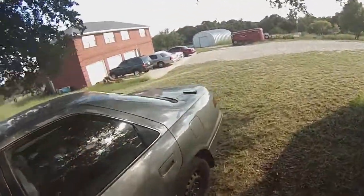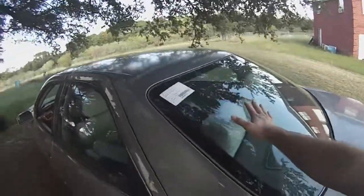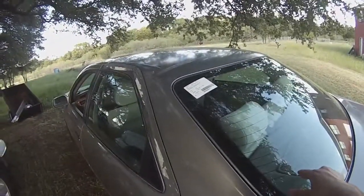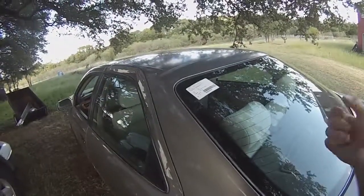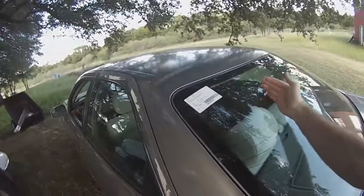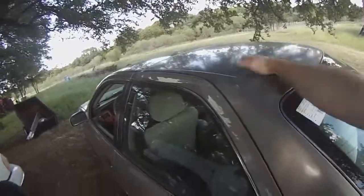What you do want to do when you put the glass on is this: some windows are going to have locator tabs like this one did up here. However, when the junkyard took this out of the old vehicle, they broke the guide pins a little bit. The tab was there, but the actual pins that hook in, the metal hooks on the vehicle where it hooks into it, were broken off. So it kind of worked, but I did have to put masking tape. I did like four strips of masking tape up here, basically just to keep it from sliding down.